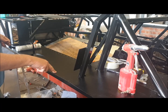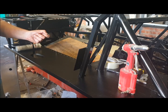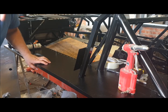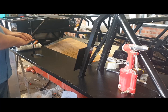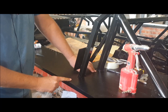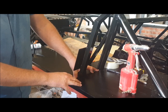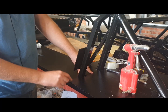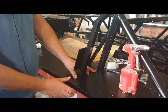For this job, because I've got a black chassis, black rivets, and black panels, I've found these nice black rivets so they blend in nicely. These are a standard thing — they are available, but you won't find them in any hardware store, they're not the sort of thing they keep in stock, so you'll probably have to order them. The next thing to think about with panels is that in places, panels overlap and need to share rivets. So you have to set that panel up at the same time so that you can drill through and make sure all the right holes are aligned. You clamp it in place, do the same thing — put down masking tape, use the elastic to get a neat hole spacing, drill through — but drill through both panels and into the chassis so they're all aligned.